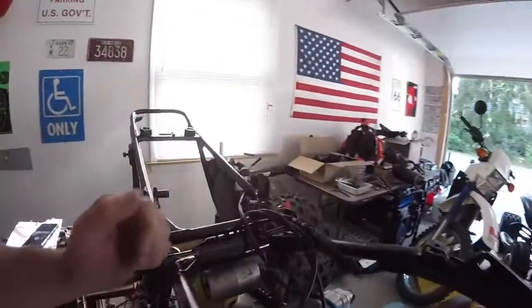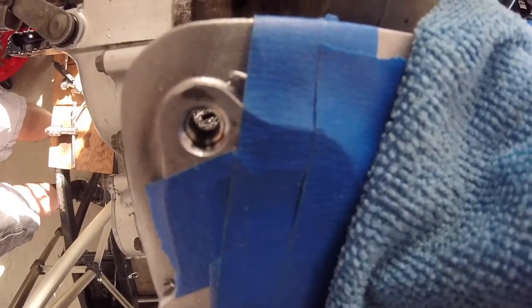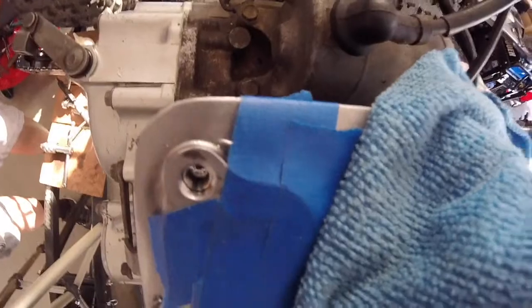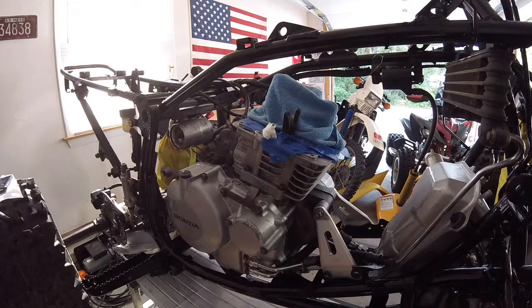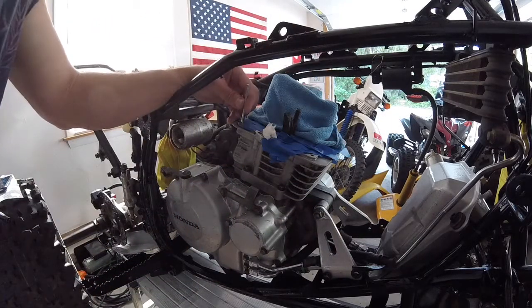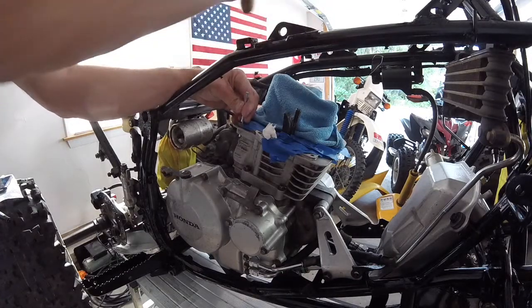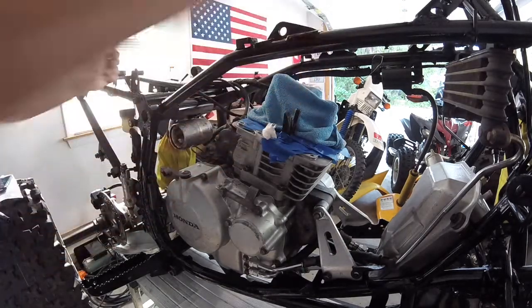Guys, have a good look at it. And I don't know if you can see that down inside the hole there. You can see the tang is down inside the hole, and the insert is now in there. And now I will grab the tang removal punch. And you don't need a lot of force. I'm actually going to use the back of my countersink. Just put it in there, and that's it. Pops right out. Now the tang is gone, not in there anymore.